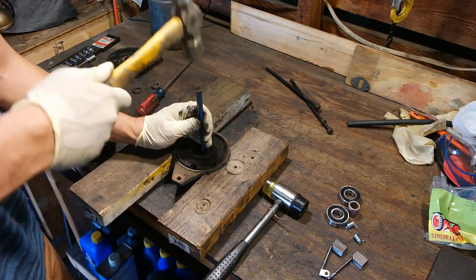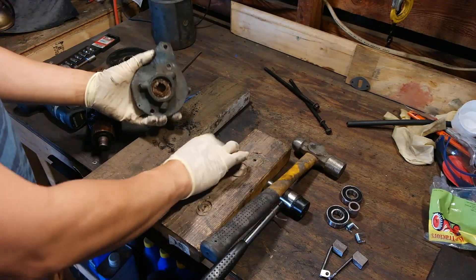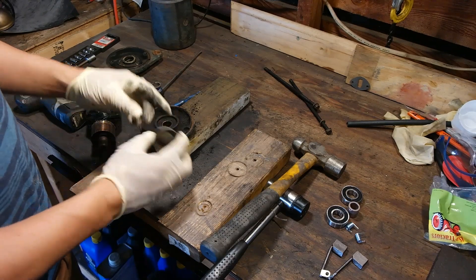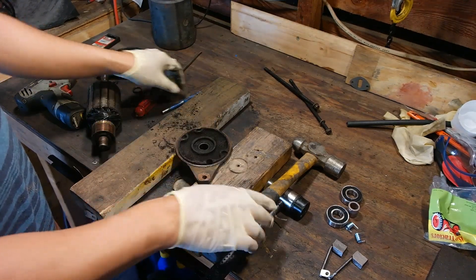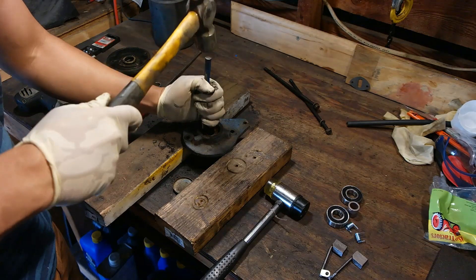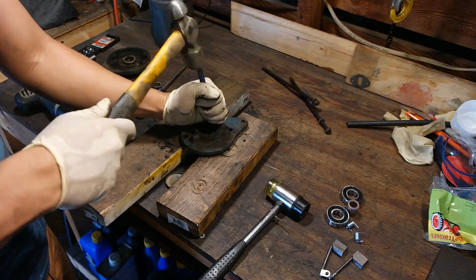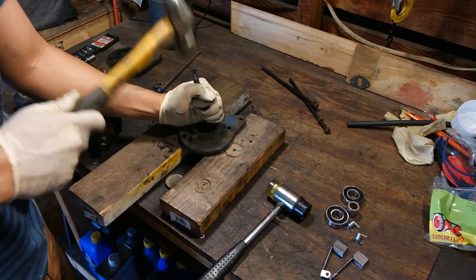Next, we're going to remove the dust cap at the brush end of the cap. I just punch it out with a little punch — it's just a small cap that sits on the other side of the bearing. Then I take that same punch and punch out the bearing itself. These usually come out really easy. As you can see, the grease that was once in this bearing is long overdue to be replaced. Be gentle and it'll come out super easy.